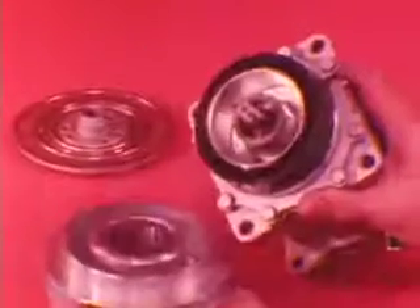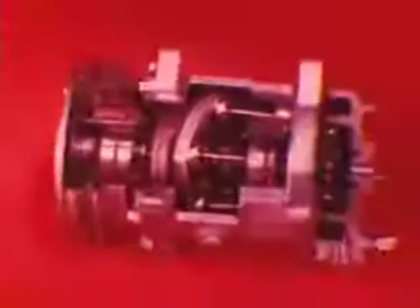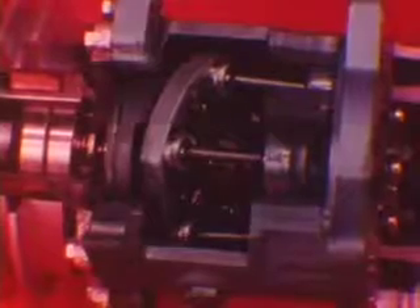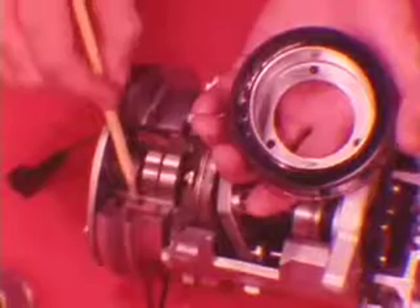Also on the Sankyo you'll see the familiar electromagnetic clutch and reed valve system. Although you may think all these internal parts are going to make your job difficult, servicing the Sankyo is really quite simple. If the compressor should develop an internal fault, you don't service it at all — you simply replace the entire unit.